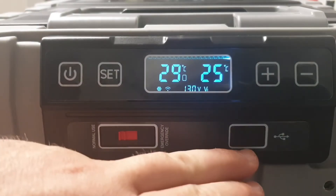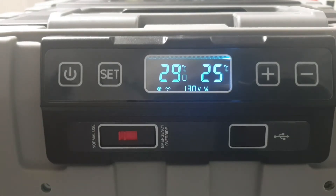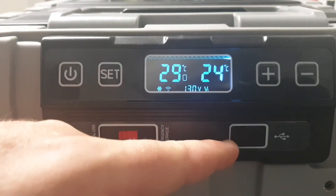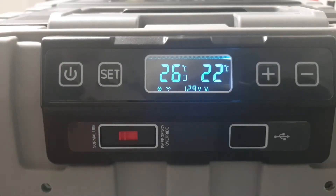The panel has a USB socket — standard USB-A — running at 0.5 amps, so it won't quickly charge your phone or iPad. It will do a trickle charge, so don't expect it to charge your phone in half an hour, but leave it a while and it will eventually charge your device. What I tend to do is plug in a rechargeable camping light while I'm driving to camp — it sits on top of the fridge and charges up ready for use in the evening.